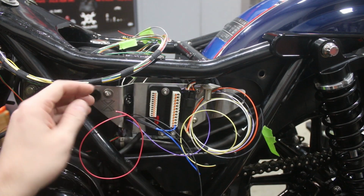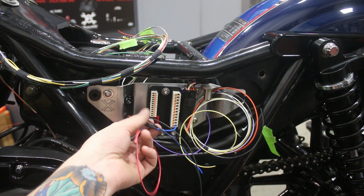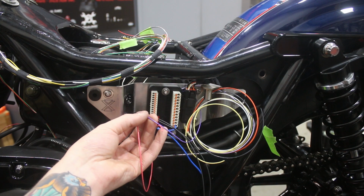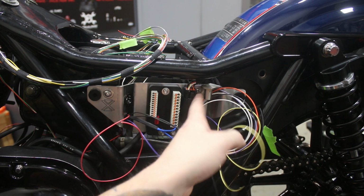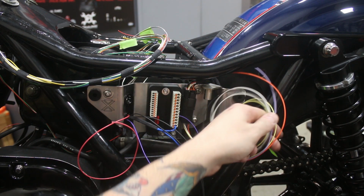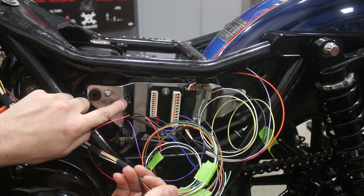We'll zoom in a little bit over here. Right, so you can see where the M-Unit actually is. This section here, coming through this lower opening, is all wires that are coming from the right side of the bike. So we've got our 2 wires to trigger the starter motor. We've got 2 ground wires here. We've got these 2: one is a brake light switch and the other one is the horn. And then we've got our rear tail light harness here. This top plug is going back to the rear fender and that's all connected. The front side is just a little service loop here, and these connections are all going to get made into the M-Unit. And then what we've got here is the bundle of the main harness that's going to come through this opening in the M-Unit.